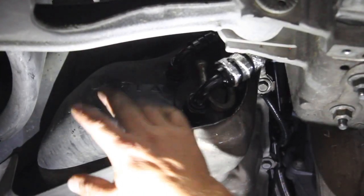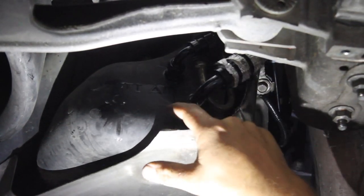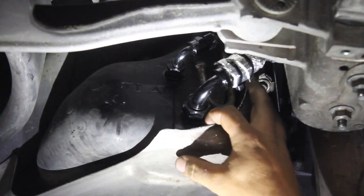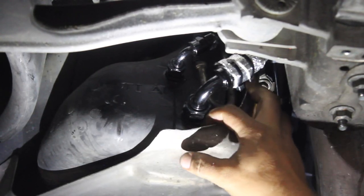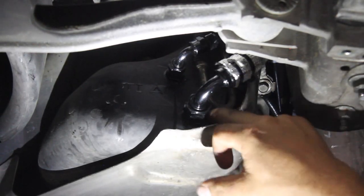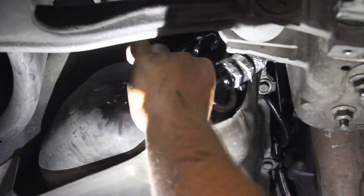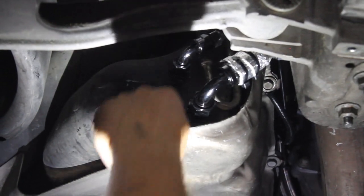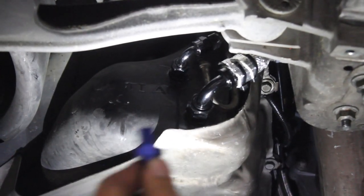Here on the back on the driver's side tank, we're going to go on the very lowest section right up against this. We're going to drill a hole in there. If you haven't drained the tank, now's a good time — it's easiest to hotwire the existing pump and disconnect one of the fuel lines. We'll drill a hole in the bottom and tap it with a 3/8-inch NPT fitting. That's national pipe thread. A little bit above that, towards the top of the tank, we're going to drill and tap it as well with the smaller quarter-inch NPT fitting.